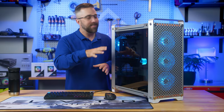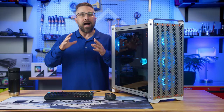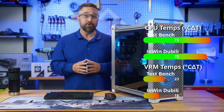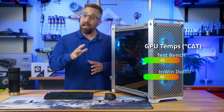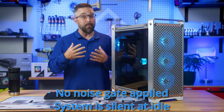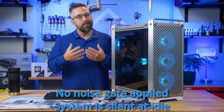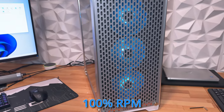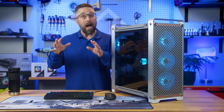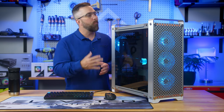Now, with the huge internal volume and four 140mm fans, the thermal performance of the case is outstanding. Comparing my standard test system inside the Doobilly to an open-air test bench: on an average of three separate 20-minute AIDA64 stress tests, CPU temperature dipped by one degree while VRM temperatures saw a more significant drop of five degrees. After running three 20-minute Port Royal loops, GPU thermal performance remained rock steady. More impressively, my case fan curve typically peaks at 90%, but with the Doobilly's Jupiter fans — which deliver huge amounts of airflow but get a tad noisy above 80% — I tweaked the curve to cap at 80% at a CPU temp of 100°C. Even so, the Doobilly still outperformed most of the cases I've reviewed.